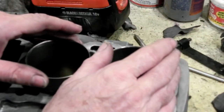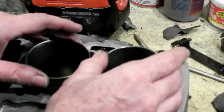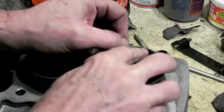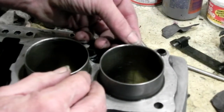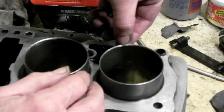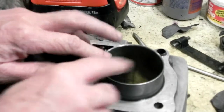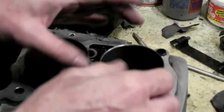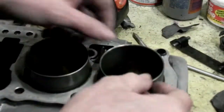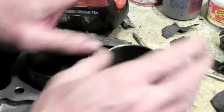When you bore a 736 kit out to 836, the bottom of these cylinders gets really thin and there's no taper. You can see I have a taper I cut, and without the taper, the bottom of the cylinder will literally cut a piston when you slide it down. It'll make a little tiny cut with just the slightest bit of pressure, and also trying to get the rings to go up without a taper is a big problem.